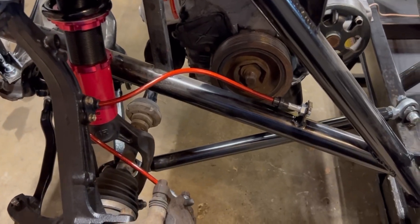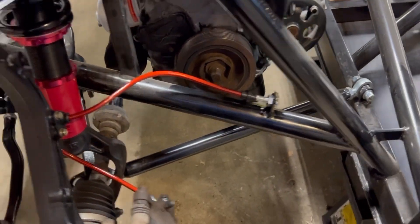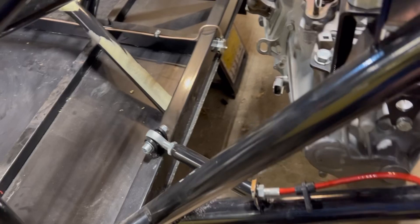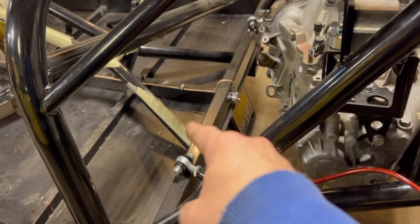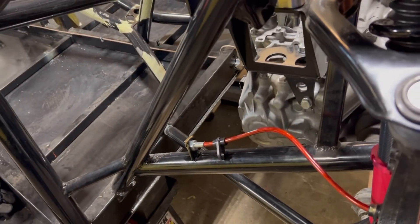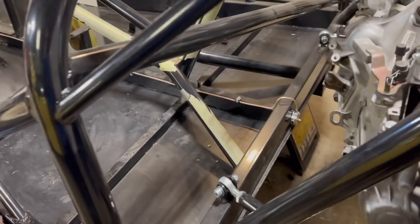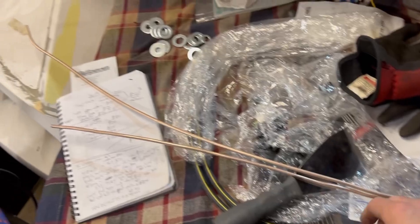I got both sides welded up and painted. This side looks more complete because the brake caliper is kind of chilling; the other side is just hanging out not doing anything. Now I need to do the brake lines, but I ran out of the Nicopp stuff — I have enough for like one side but not both. Now I need to decide if I want to just run steel lines back here or spend another $75 on a roll of Nicopp when I have two rolls of steel I could just use. I'm kind of leaning towards just using the steel — we'll see.